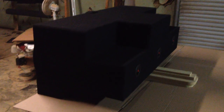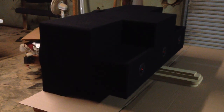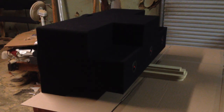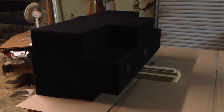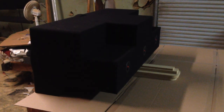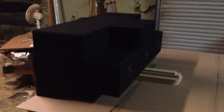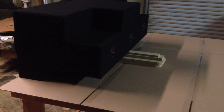Let's walk over to the side. This box is sealed and it's got three separate chambers. Frank is going to have some aftermarket 6x9s, so we had to make this little cutout right here, because the factory comes with 4x10s underneath the back deck. You can get some adapters and change out the 4x10 into 6x9s and it does kind of drop down considerably — probably half of that back side is taken out just for the 6x9s. I've got that wood there just to prop it up because this box actually crawls up into the shelf of that trunk.